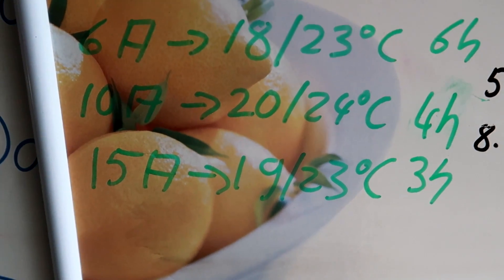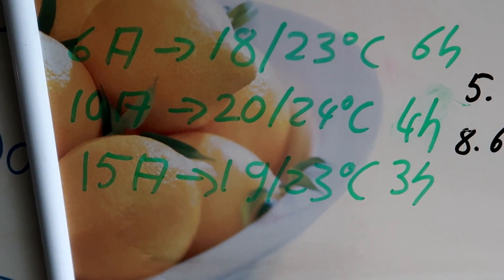So I just wanted to explain what actually happened with these different settings. If you charge your car on 6 amp, 10 amp, or 15 amp, it seems it does not really matter in terms of battery temperature in the morning. We had fairly constant outside temperature, so it is quite comparable, and regardless what setting I used, the temperature was almost the same in the morning.